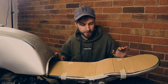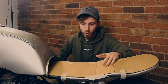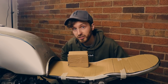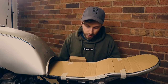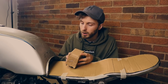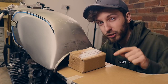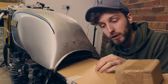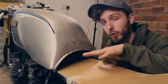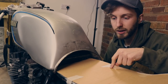I am really happy with this — it's just a nice, smooth, plain canvas for us to work on. There are going to be some alterations, however. Before we start getting the hump shape and working on that, there is an issue I need to tackle — and that is where the battery is going to sit, because the new battery is this size. Some people may put it elsewhere, maybe a little compartment underneath or a little bag underneath the swing arm. But I've got a different plan to make it tucked away — to sink it down and have a little drop-down section underneath the frame where the battery will sit lower down. I need to account for it while I'm fiberglassing, so I'll make a little section here raised. That will give me the room needed for all the electrics to sit underneath. So I'm going to do that now and then we can start working on the seat hump.